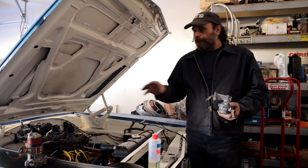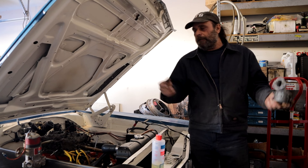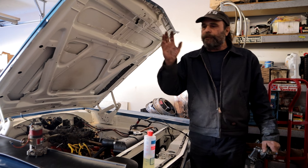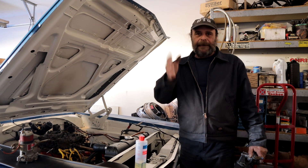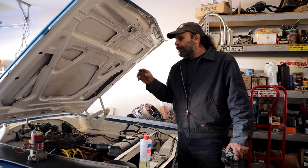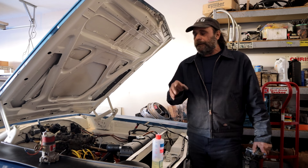So we're done with mechanical fuel pumps on this thing and we're going to go strictly electric. Now, what pump do you choose? There are certain rules that apply across the board for street and strip cars — not race cars, just cars from 300 to about 500 horsepower, normally aspirated, nothing exotic. A pump of approximately 50 to 60 gallons per hour will support approximately 500 horsepower, normally aspirated.